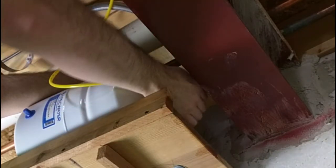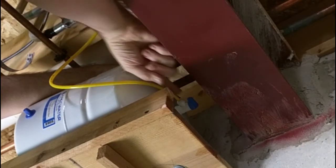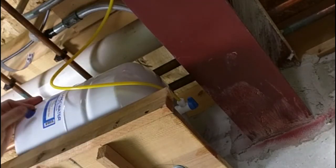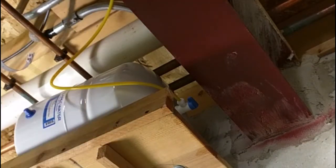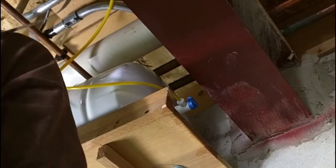I'm going to make sure the valve is on. Parallel to the cable is the on position. We're not going to mess with the Schrader valve because it's already pressurized to probably 7 psi. I'm going to put the straps back on and turn the water supply back on.